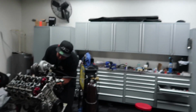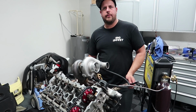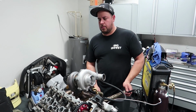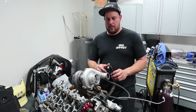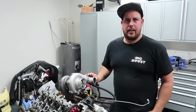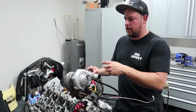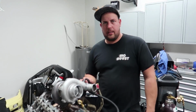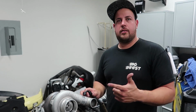While I was at CW Pence, they also checked through everything. They actually disassembled the bottom end, made sure that the pistons and the rods and the rings are all good. Everything looks mint, so mint. So we're good. It's really weird that I pulled it like that. I never had that happen on any SR. Do you agree though it's probably just an air pocket? Probably. Especially with the turbo being high, it's a little bit harder to bleed, so it could cause a big air bubble to form. We're gonna have to be very thorough and bleed the car really good this time.